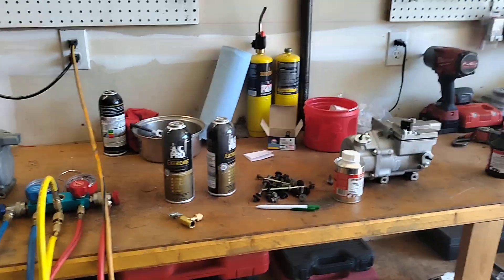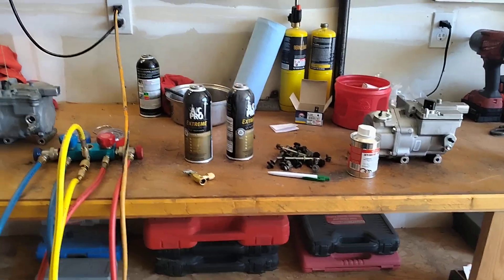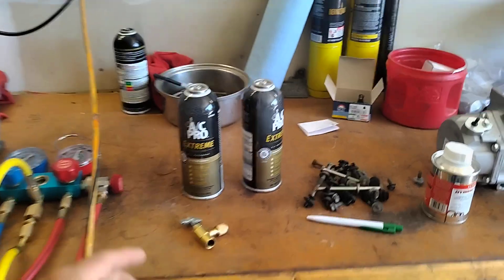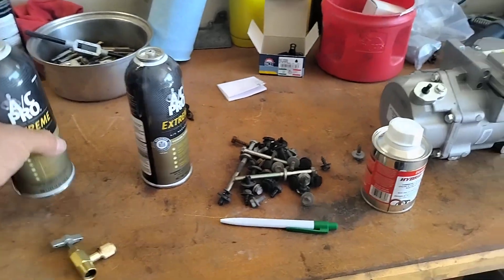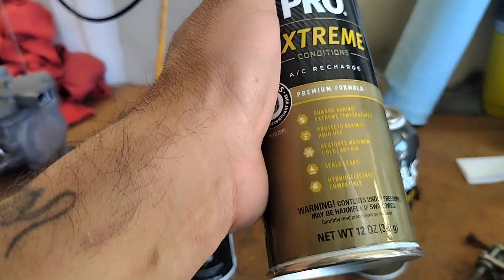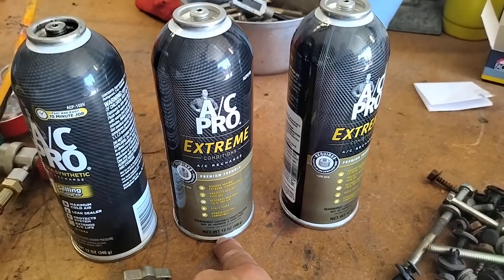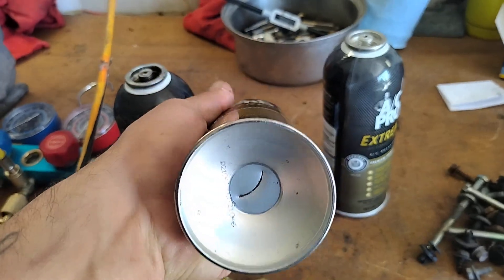This compressor takes four ounces of PAG oil and 17 ounces of freon. On an EV or a hybrid you need to make sure that you're using freon that is hybrid electric compatible — you can't just buy any freon. There's AC Pro Ultra, ultra synthetic, and AC Pro Extreme for extreme conditions, which is good for hybrid vehicles. All freon cans — if it says 12 ounces, that means about 10 ounces of actual freon and two ounces of additives and oils. Hybrid electric vehicle freon does not have the additives or oils in it that are bad.